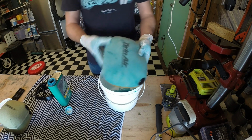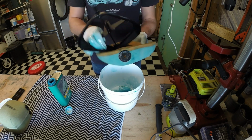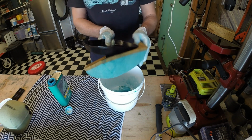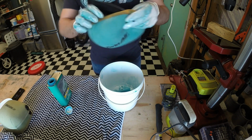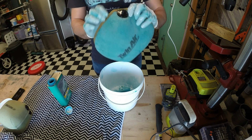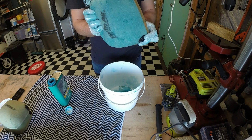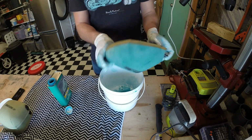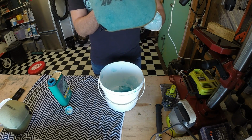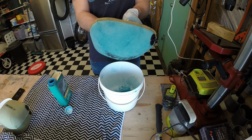Okay, now that's looking pretty good. I've got the cage right here, so while my hands are all covered in filter oil, I will pop that in. Oops, wrong way. Be careful putting these pins through. Make sure that they're going through the rubber before you fit the cage. If you don't, you will pierce the foam. Ask me how I know. If you pierce the foam, throw the filter out. It is not worth the risk. $30 filter versus hundreds of dollars fixing your engine.